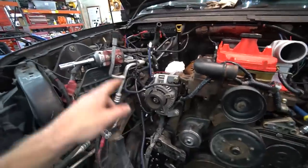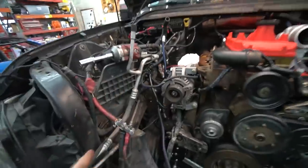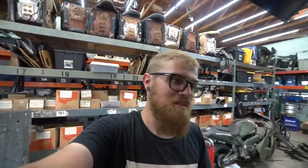I'm going to go underneath, hook up the starter power wire, run to the store, get oil, fill it with oil, and new filter. Then it's pretty much time to start it — throw the batteries in and try. I'm a little nervous because there are a lot of question marks. The injectors might not be good, it might not start, they could have gotten stuff in them while sitting out of the engine. There are just a lot of things that could go wrong, and if it doesn't start it's going to be very difficult to diagnose.